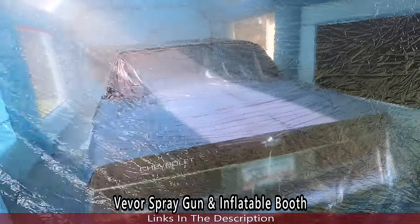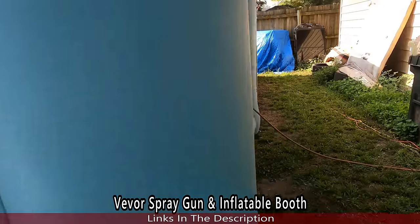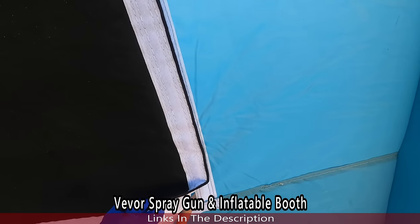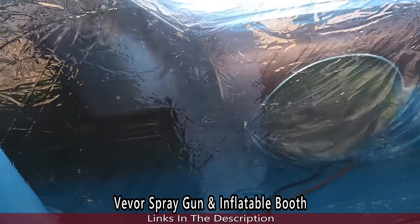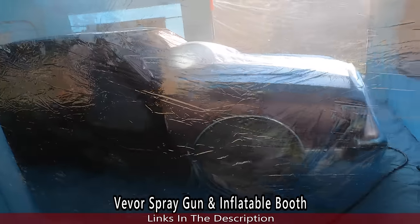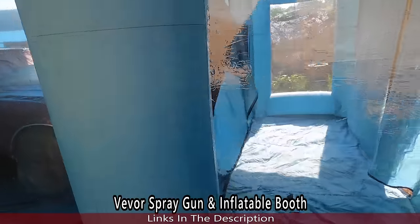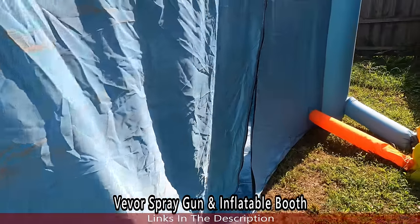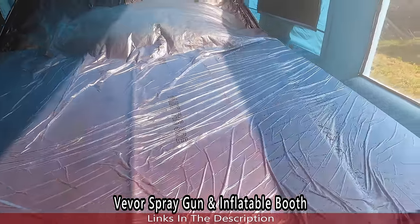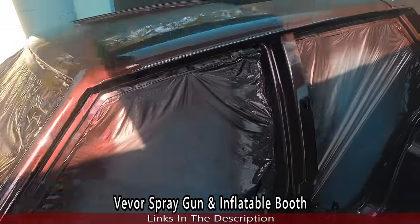I just finished spraying the last coat of clear. Once you pull out the overspray, I'll take you inside. I ran my air hose through that opening now. Well, I probably can take it inside now. Still a little overspray up in here though. Let me show you what it looked like.